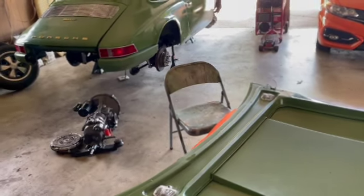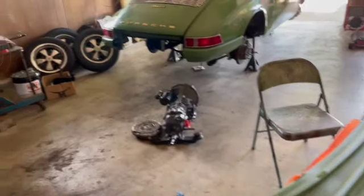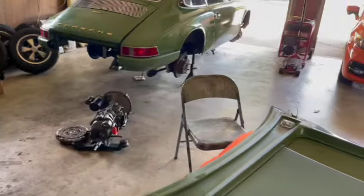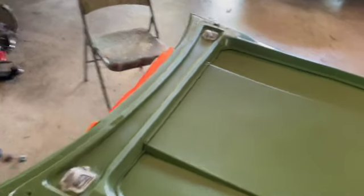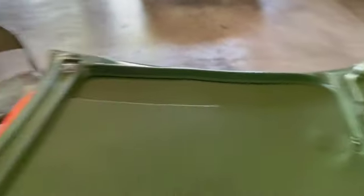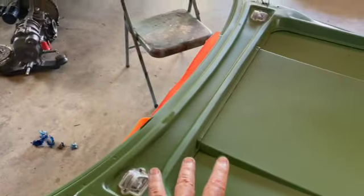Okay, Labor Day Monday. So just thought we'd put the hood on, waiting on fuel lines. Got 5mm, 7mm fuel hose, actually. Normally you'd run the hoses before the engine's in there, but I figure we might as well tidy up under here and clean our lights, get new bulbs in, install those, install the latch, it's not tightened, and try to put this on without scratching the car.